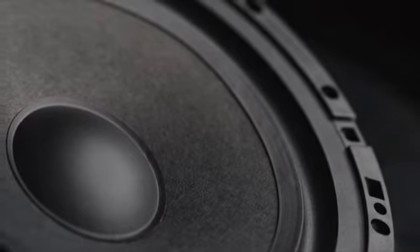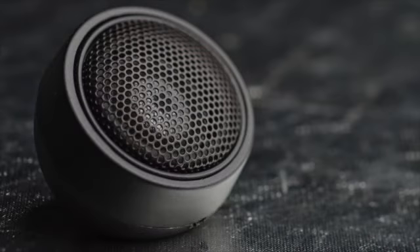The Claris kits all include a component tweeter pair, the exceptional Claris C1 competition-grade tweeters. The C1 driver is a 20-millimeter diameter impregnated silk textile dome neodymium tweeter with high-loss rubber suspension for exceptional polar response.